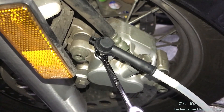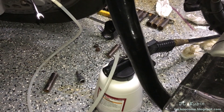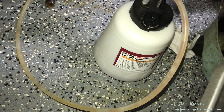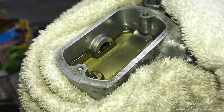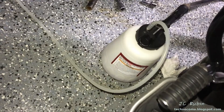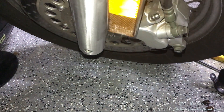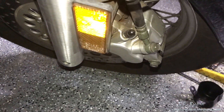The same procedure for the second caliper, except a little harder to work — you can't move the handlebars or the reservoir will tip and get brake fluid all over the place. So I'll sneak down here, remove the cap, drop the spanner on quick, and come around with the bottle. With the pneumatic bleeder set up and ready to go, I top off the reservoir first, then turn on the vacuum and repeat the process. Once complete, I take it off — everything's nice and tight and clean — drop the rubber cap back on and we're done.